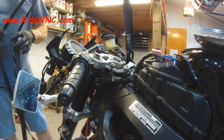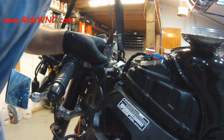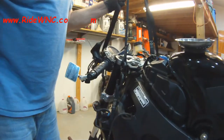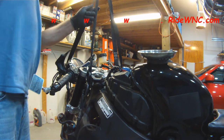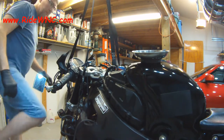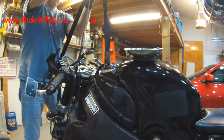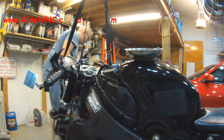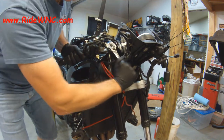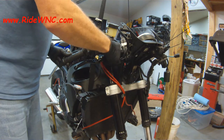Right now I'm going to take ratchet straps and put them through the frame, and I'm going to hang the bike from the support of my loft in the garage. You can do this with an engine hoist — just be careful. My bike is still on a pitbull stand, so I'm just removing some of the weight off of it. I want the bike to hang evenly — it's easier to align the bike if it's hanging freely. We have our hex tool and we're loosening the two hex screws holding the triple tree and the clip-on onto the fork.